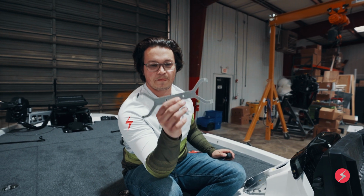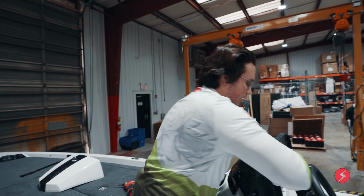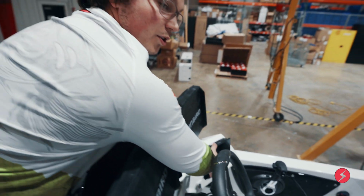As you can see, those are the 2 holes where the screws go in. So after you uninstall your X bracket, you'll be able to push back here on your screen very lightly, and it should be able to pop out just like that. And you want to hold on to it so you don't drop it.